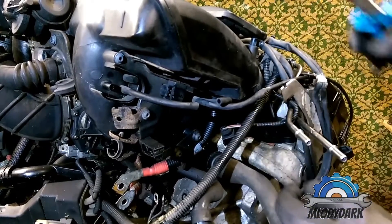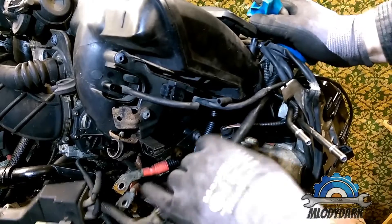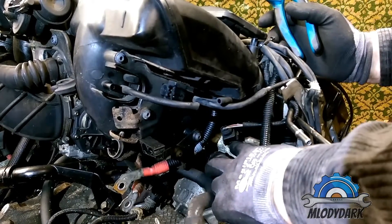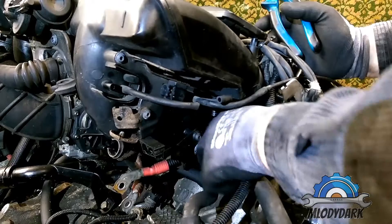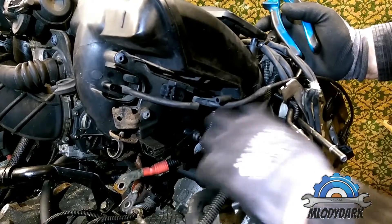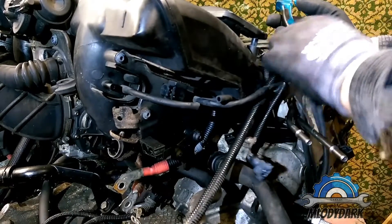This has been cut before. Also important — this is the location of your coolant temperature sensor. It's mounted behind, in the back of the cylinder head, below the intake manifold. Same as the M54 engine — no difference there.